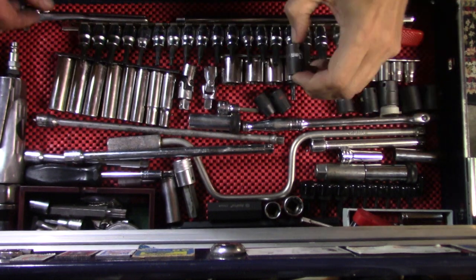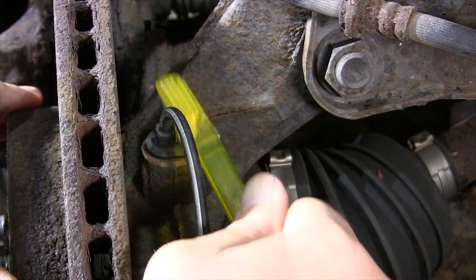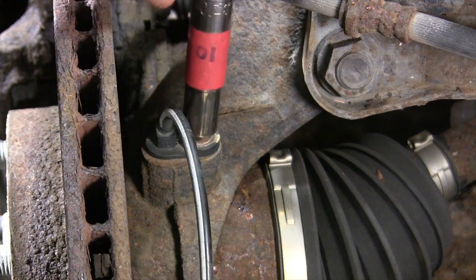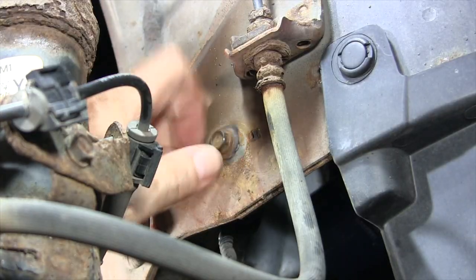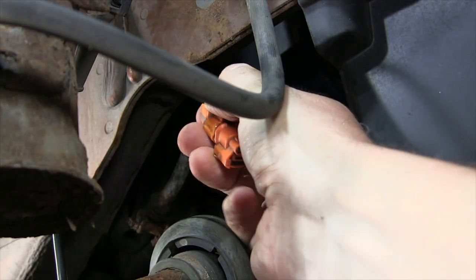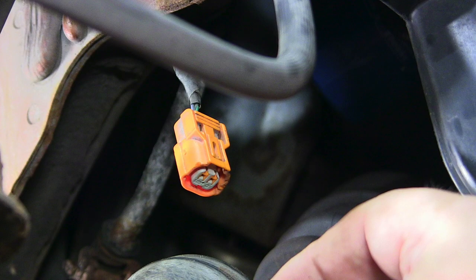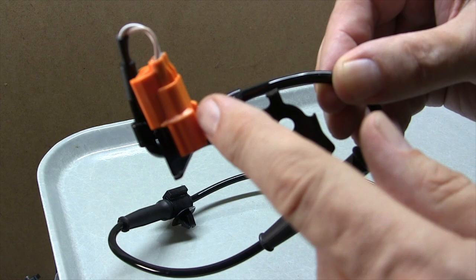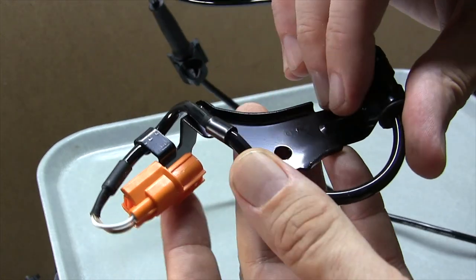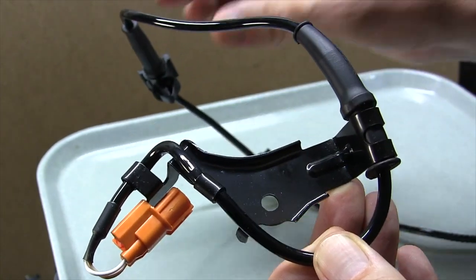It's time to get out some tools and get to work. My first priority was to clean off the dirt and rust from the bolt heads. Next, I wanted to loosen both bolts to make sure I could remove the old cable. I then unplugged what was left of the old connector. Fortunately, the part attached to the body was undamaged and still in good shape. The new wheel sensor came attached to the correct bracket. On the body connector part, there was some strain relief and a new metal bracket — they have strain relief at all the stress points.